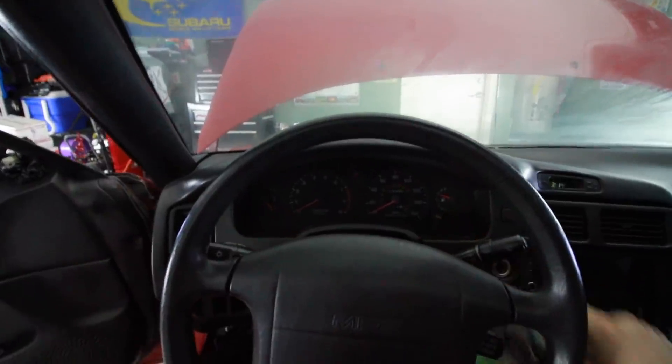Still dies — well, that's actually good. That means the fuel pump is good to go; I can hear it come on as soon as I start the car, working as it's supposed to. With the resistor deleted, the fuel pump gets full power all the time — no more low voltage mode and high voltage mode. That's fixed. This car will run now; we just have to figure out the idle air control valve.